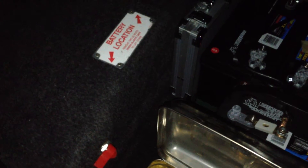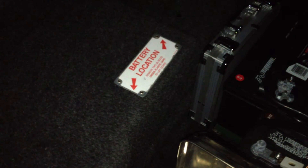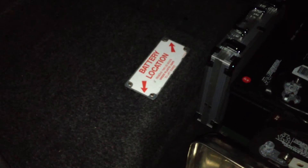The main drivetrain battery pack, and then under here where the original starting battery is, I have two 12 amp hour — so a total of 24 amp hour — deep cycle mobility scooter batteries, absorbed glass mat, to power the accessories and electronics. I had a problem with draining and used the small scooter batteries to reduce the weight on the car. It made a difference — I have 10 pounds worth of auxiliary batteries instead of 60 or 70 pounds with a full-size battery.